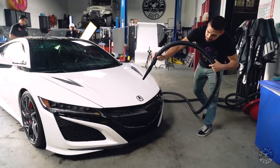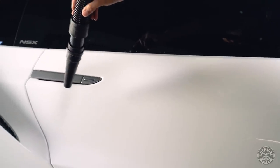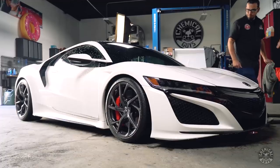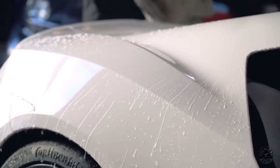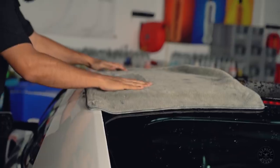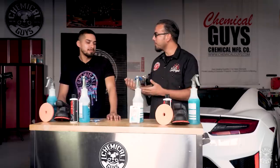So we've just brought the NSX into the Detail Garage and we've dried it using an air blower. The reason for that is because this car has a lot of crevices and tiny cracks where water gets trapped and it also causes water spots. By using an air dryer it gently blows it off the surface, and we come back with a clean microfiber towel to wipe it off — we chose the Woolly Mammoth because it's very plush so it absorbs a lot of water, but it's also very soft so it doesn't induce any kind of scratches or swirls. Now we're moving on to the next step.